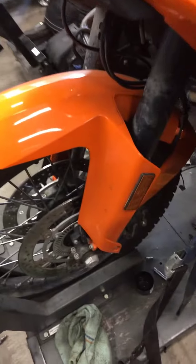Also with that, 34 psi in the front, 37 in the rear. Front brakes look great still, on both sides. As well as your fork seals — they aren't leaking as far as I can see right now. All good there.